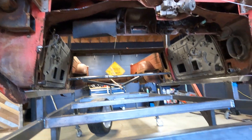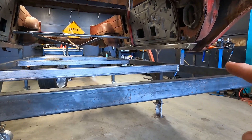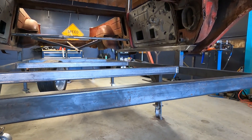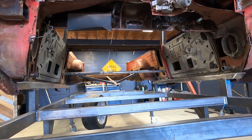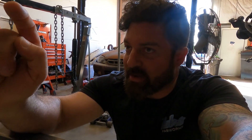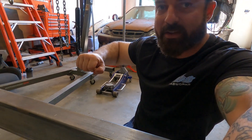We only have so much of a limit down low. That's not my real rocker — my real rocker is that piece back there, so imagine an invisible line there too. The whole idea is I don't want that pan to be lower than that rocker. We're going to have to find a happy medium where the engine is as low as possible, on the centerline of the wheel hub, and as far back as I can manipulate it without making driving a living hell. Now that you guys are up to speed, let's take some measurements and really figure out how we're going to get the engine in.